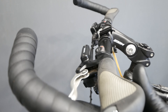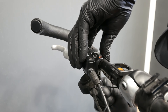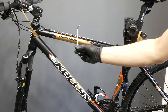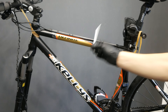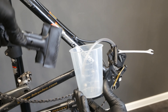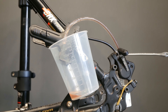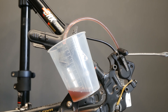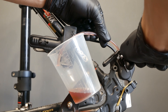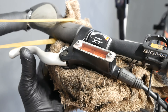Now I will show you some homemade tools for the bleeding. This is the rear brake. Leveling the reservoir and just work on the housing. When you see that the housing has some turns or curves, just make sure nothing will stay there. You can simply use a plastic cup and somehow assemble it to the frame — easy peasy. Now you'll be able to use the syringe and just reuse the oil while working on the whole system. It took me not more than 15 minutes on one brake. Easy job — you'll be able to do it. Now it's working perfectly.